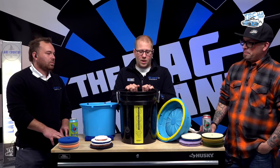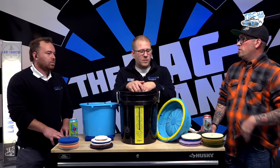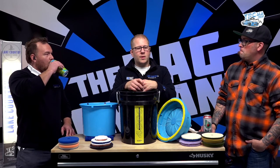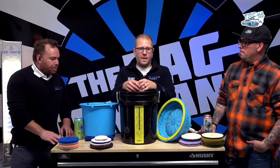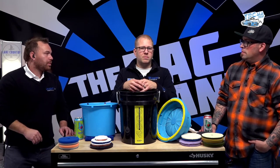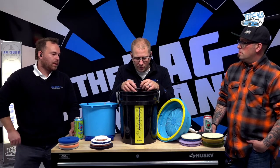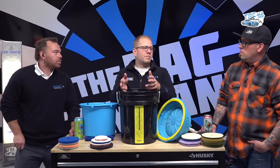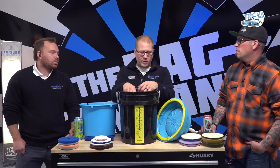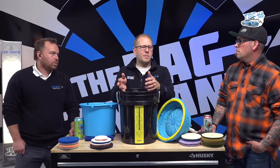But no, I think they're great. They're great for marine detailing too. Not every boat's gel coat, but the majority of them. That single stage is messy. You still get residue with your traditional clear coats, but with single stage paints, you obviously see that. It's a different type of residue, and the same thing with gel coat. Boats are made with gel coat for the most part, so residue control is a big deal. Being able to clean your pads on the fly in a nice way, like with the System 4000, is huge. When detailing boats, pads get clogged really quickly.